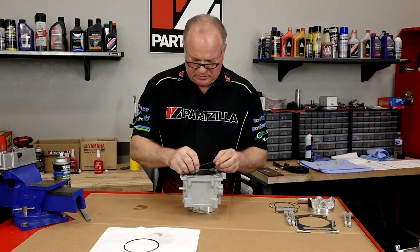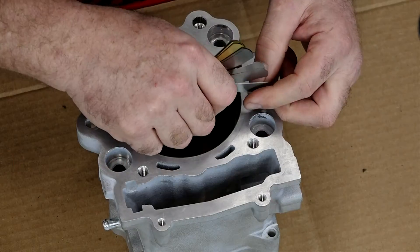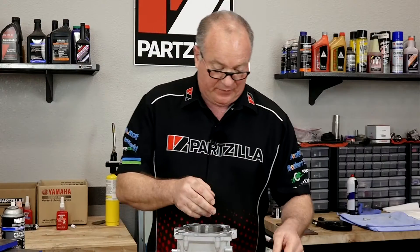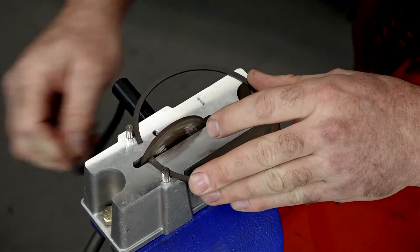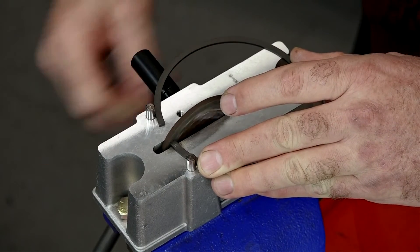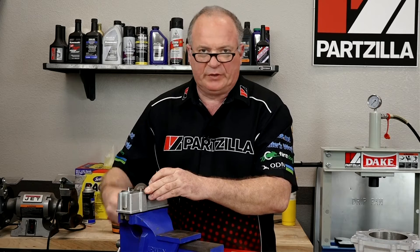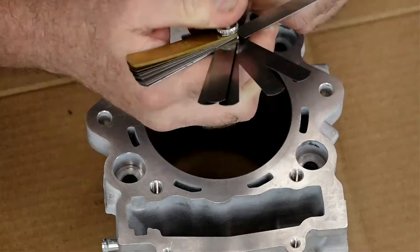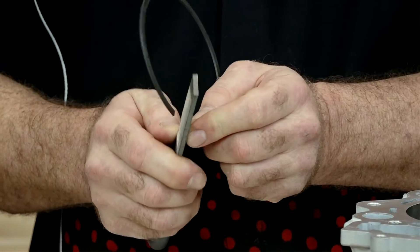Next we can work on our number two ring. As I said earlier, it's a little bit different than the top — we're looking at 20 thousandths for this one, so a little bigger gap. Nine just barely went in there, ten will almost get stuck. So we've got a fair amount of work to do here — we basically have to increase that gap by that width. This may take a few minutes. It's much better too loose than too tight. Twenty-two just barely starts to catch, so I think we're there. Just need to clean up that lower edge and the outer edge, and we should be good to go.